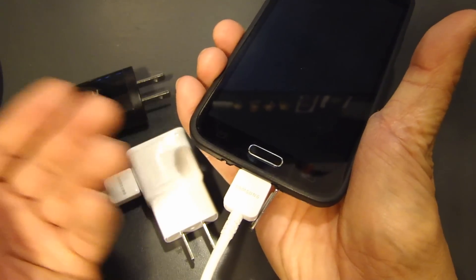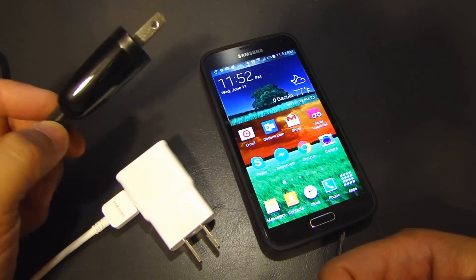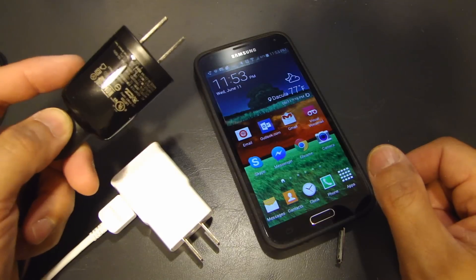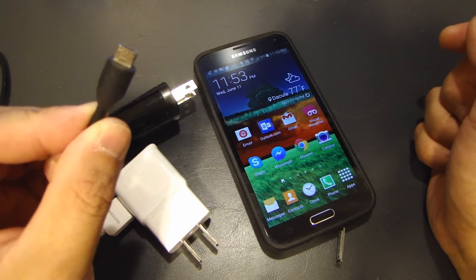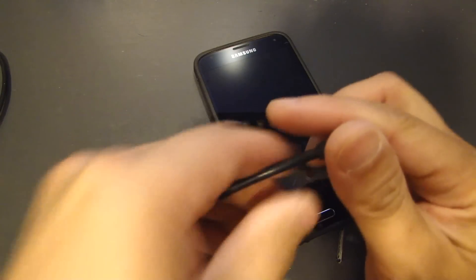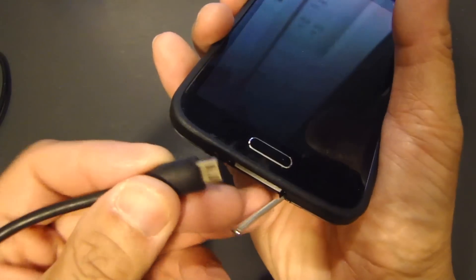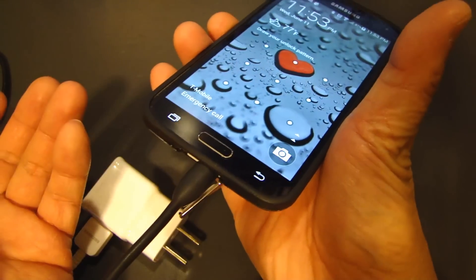So this is how you would charge a phone. Some of you may not know that you can actually use a regular USB 2.0 charger to charge this new phone. Over here in my hand I have an older charger for my last cell phone. This outputs one amp, and on the other end of this cable, this is a USB 2.0 micro B connector. I'm going to plug this into the wall socket, and all you have to do is plug this connector into the USB 2.0 side of this bottom connector.